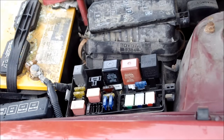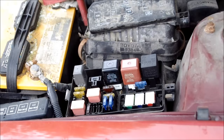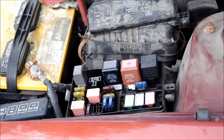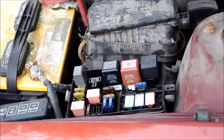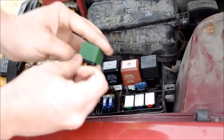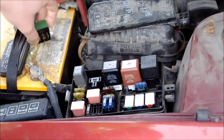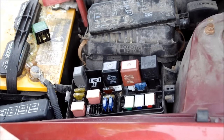If the circuit is open, that means the fan has burned out — that's the best way to test this. Unfortunately the contacts for the fan were very hard to access, and since I was confident that these two are what power the fan, I just decided to short them out with a paper clip. The ignition will need to be on, so I'll turn that on. Double check which contacts are the switch — we have 87A and 30. If I short these two with the paper clip, the fan will run if it works.